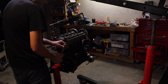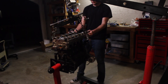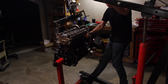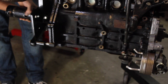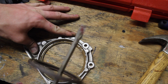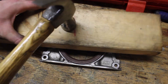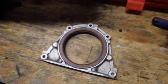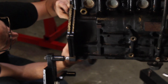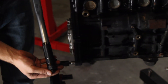For your comedic value I'm going to try to work on the rear main seal now. I have to use the engine hoist, get it off of the engine stand, and that is always fun. Removing the rear main seal isn't just nuts and bolts — I tried prying it out from several different angles, really trying not to ruin the housing. Installing the new seal was even more difficult because it wasn't just pressing right in. I used a hammer with a piece of wood to avoid damaging it. Lining the rear main seal onto the block and getting the seal to sit flush on the crankshaft is equally difficult. I ended up tapping it with my hand and then used a bolt to tighten it the rest of the way and torqued it down to spec.